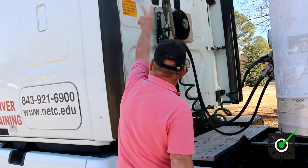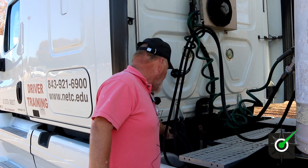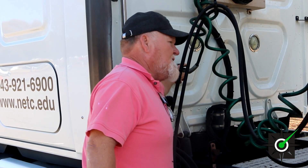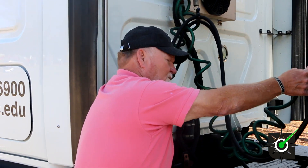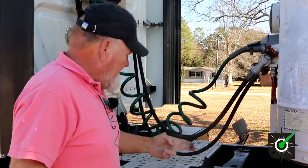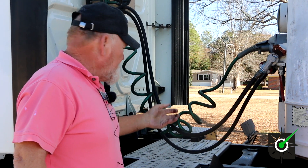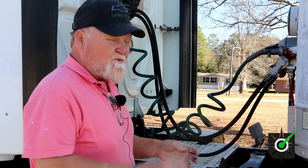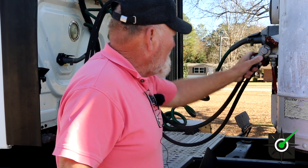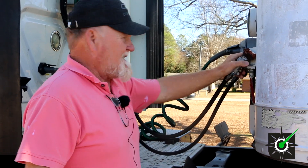We have two reflectors on each side — they're clear, properly mounted and secure. From there we've got the airlines. The airlines bolt onto the truck — they're rubber, so no abrasions, bulging, or cuts. You don't want them leaking. You've got a power cord that comes out the back of the truck, and the trailer where it hooks — where the power cord plugs in — they're on with safety latches. The power cord has a rubber coating — it can't have any abrasions, bulging, or cuts. It has electrical wires inside; if it's cut or damaged, the wires can touch inside and short. The airlines hook and unhook on the trailer with a glad hand. They have a rubber seal — no cuts and abrasions, and it doesn't leak.